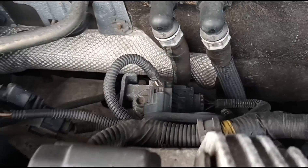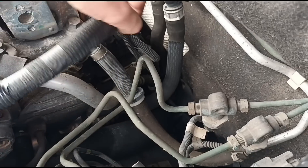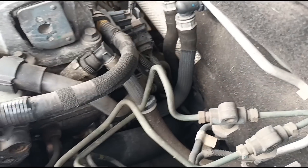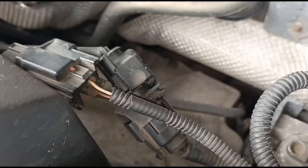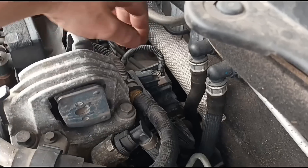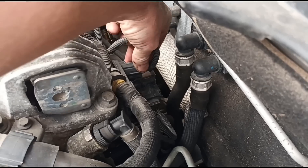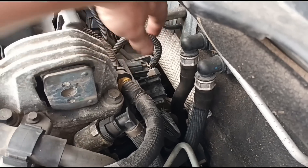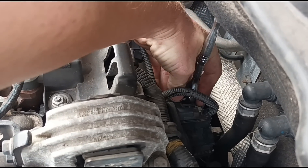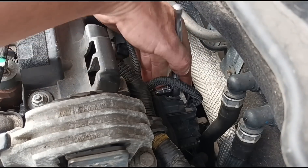Now the sensor is just down there with this plug on it. The first thing I'm going to do is look at the tubes, see if they look perished or split — no, they look fine. This also had a new oxygen sensor. I'll check all the basic stuff first: is it plugged in? Because I've seen that loads of times where someone's been messing around with the car and just hasn't plugged it back in properly. Each side of the sensor here we have a T30 Torx bolt or screw — just get those open.